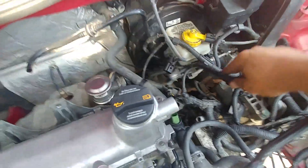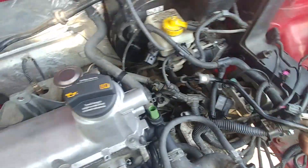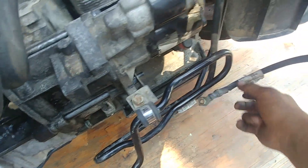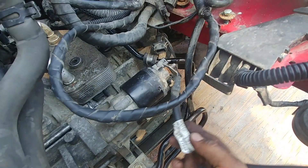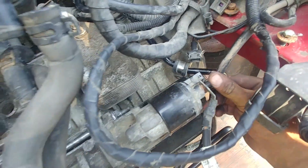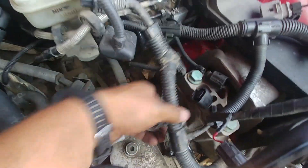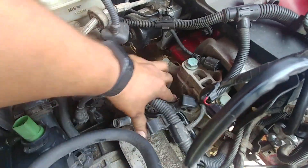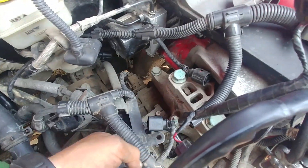There is our power steering high-pressure line — arrange the fitment so the harnesses aren't entangled. Make sure everything is in the same original position. There are brackets showing how it goes and certain places to attach. Make sure all cables are secure — there's our cable to the starter solenoid, the hot wire, and plastic mounting brackets to hold the harnesses.